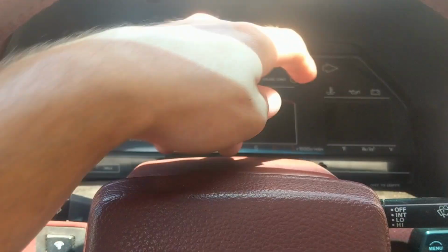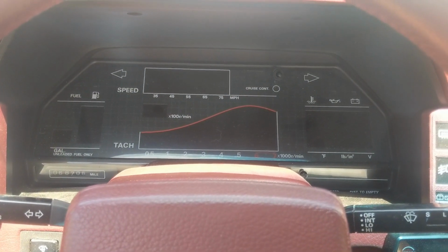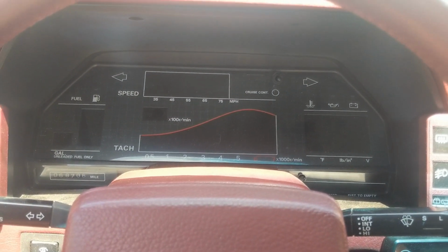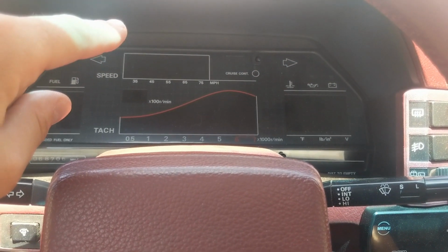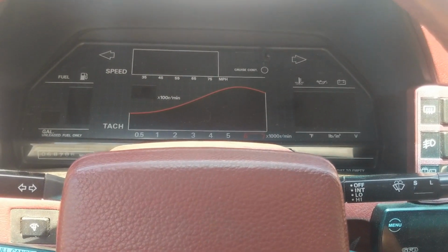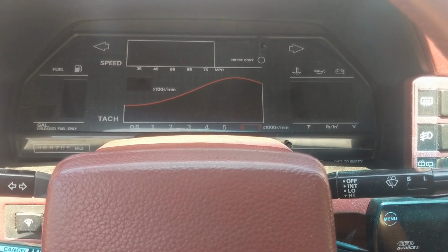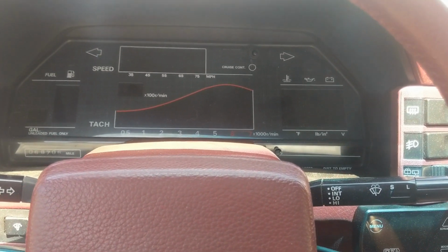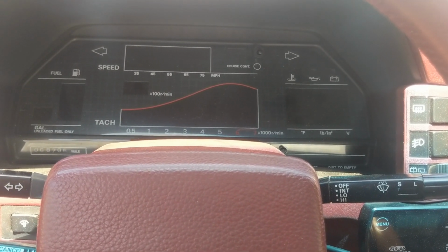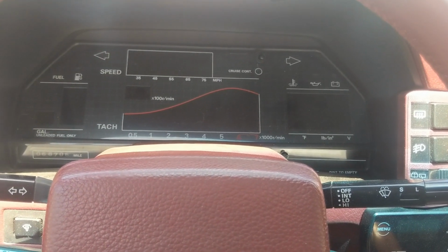The coolant is wired to just the stock Nissan coolant temp sensor for the dash. That's actually sitting in the passenger side head, and then the stock GM sensor is on the driver side head. That goes to the gold box. That lets it know when to turn on the electric fans and such. So I bought an adapter from Mark's 4-wheel drive out in Australia. It wasn't really that cheap, but I wanted all my stock gauges working. So, did what I had to do.